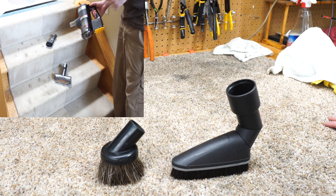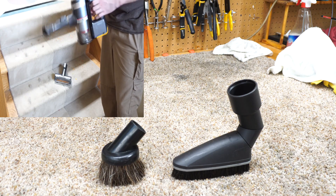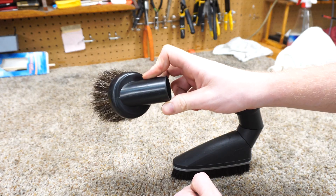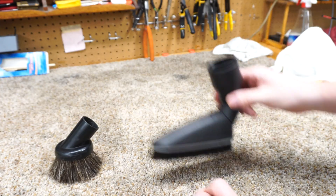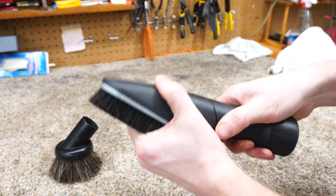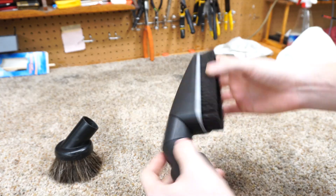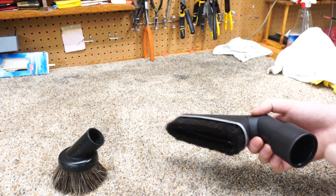Let's talk dusting brushes. You guys seem to have recycled the dusting brush from the Dyson DC24, later used on their stick vacuums. It's a really poor dusting brush unless you're holding the vacuum in your hand and using it at an angle. Having a dusting brush with a traditional angle is very good — you'll find this on hundreds if not thousands of different models. This is basic, good, and commercially available if you don't want to make it in-house. A more creative option that might be more of an LG solution is putting some sort of swivel neck on your dusting brush with reference points — this one actually clicks into four places, and a single joint works just fine. That would be a big improvement in usability, and you'd be kneecapping the competition that's using that tool Dyson uses.